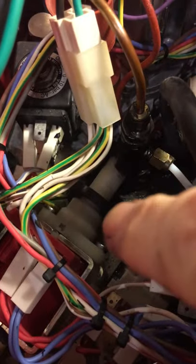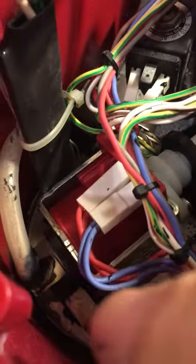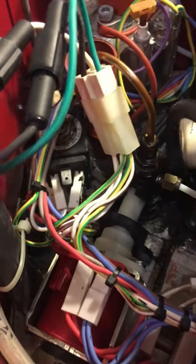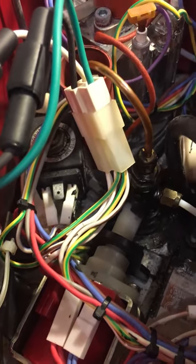The pump is held in by two black L-shaped rubbers and a clamp. So if this is the bottom tray, there's a clamp held in there — you just need to prise the metal up with a screwdriver on both sides. Once you've got the case up it's easier to get to. Note your two cables and which way around they go, then it'll come out.